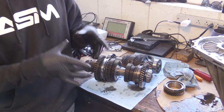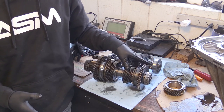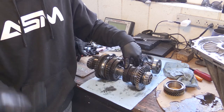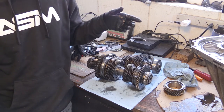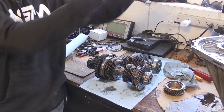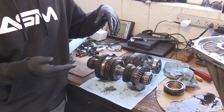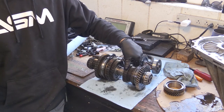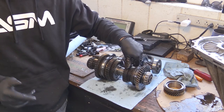The reason I think 5th gear fails is, for one, it's a smaller gear with a smaller synchro — so you have less surface area. The bigger the gear, the bigger the synchro and the more surface area you have. The next thing is 5th gear is a massive overdrive for cruising down the highway — it's not meant to have full power shifting. If you look at any race or sequential transmission, the ratio between 4th and 5th is very close. But on a daily driver, you want to drop down to a comfortable RPM at highway speed. With a stock Evo 8 or 9 trans on a road course, if you go to 5th, you just stop accelerating — 4th has great power, but 5th just falls off completely.